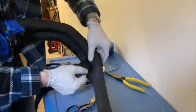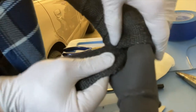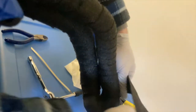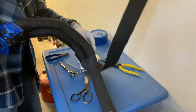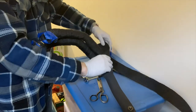The real trick is to keep rotating that roll and give yourself enough slack. As you zoom in, you can see the idea is to pinch inward and then fold over, so we can send the roving back up. There's not a lot of clearance on the Yamaha's pipe assembly, so I couldn't do any more than two layers. Here's the result of that two-layer setup.